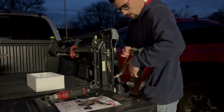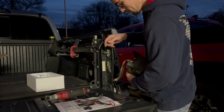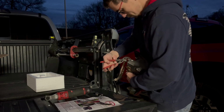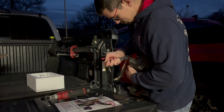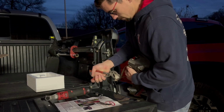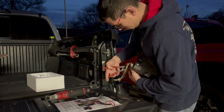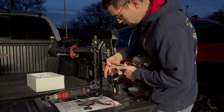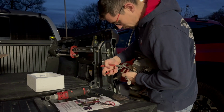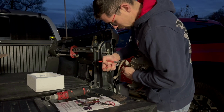And then you want to remove the plugs. Hand me those channel locks. I'll try and pull them from the housing this time. You want to be gentle and not break the clips. They are plastic, and depending on how old your Tacoma is, the plastic gets pretty brittle and can snap. So you want to be extra careful as you're pulling them out.